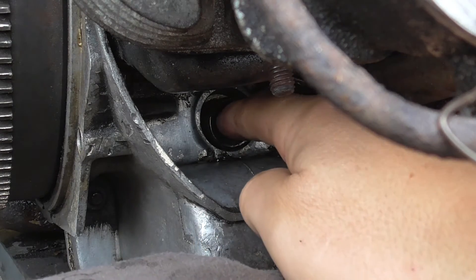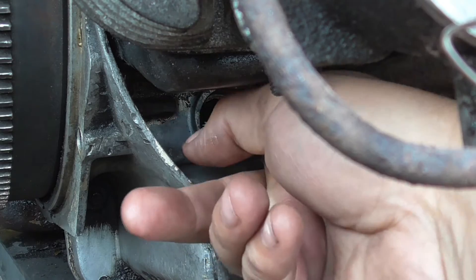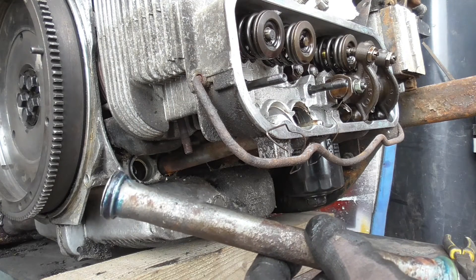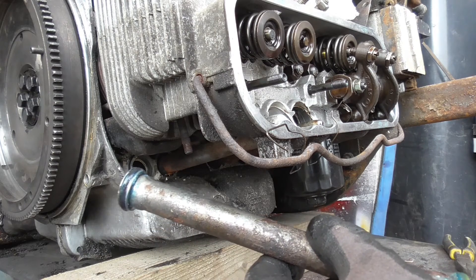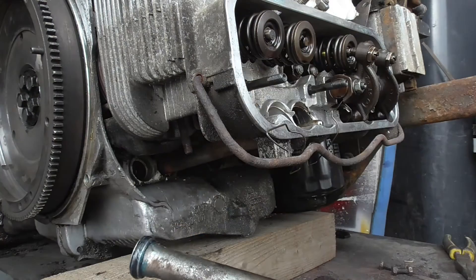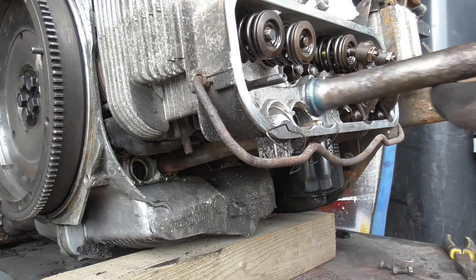I held it with the magnet so it wouldn't touch anything around the outside that isn't perfectly clean. I'll probably get shot down for this because I know I should have replaced the seals — they should be a good fit and work as intended. However, I only took it apart yesterday and want to get it back together quickly. What I've done is apply a very small coating of blue Hylomar on the external edge only — it's not silicon-based and is used for sealing around oil — so it shouldn't get into the engine, but might help if there is a sealing issue.